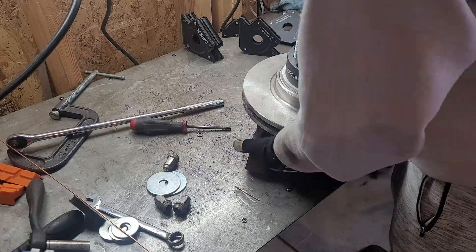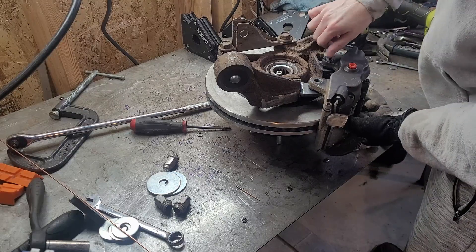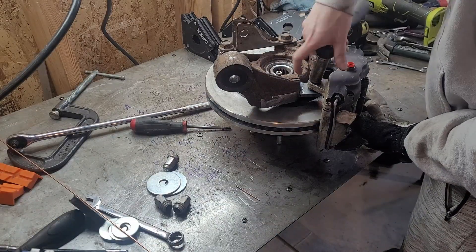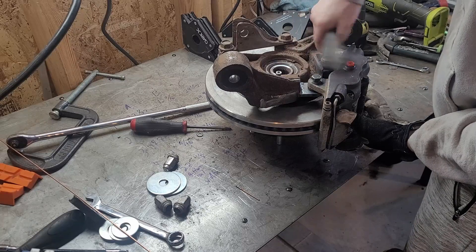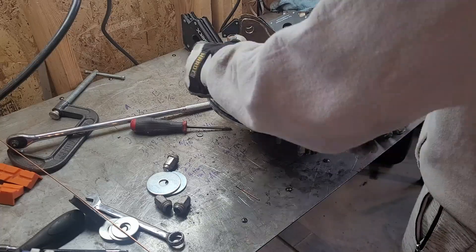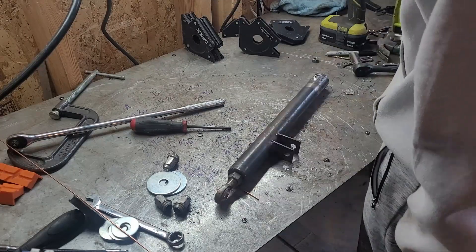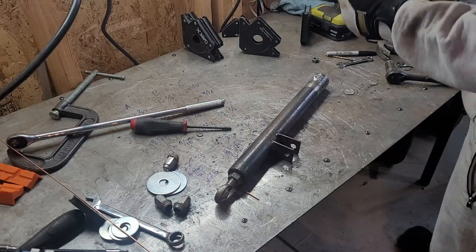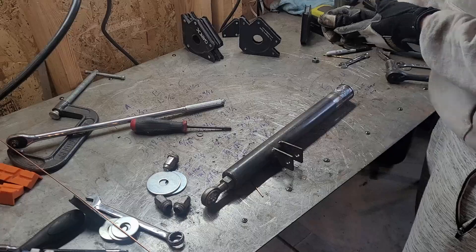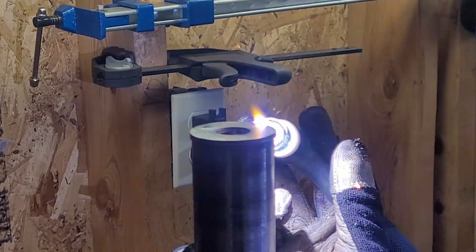This stack-up is very important — that was the required offset for my wheels to clear the calipers. I required an inch and three-quarters of offset just to clear the wheels, which is the downside of running very large brakes: your wheels tend to hit them. Now it's time to modify the upper arm, since we got rid of the pronged approach I had previously — that was out of necessity to keep the knuckle from translating forward and backward through its motion.